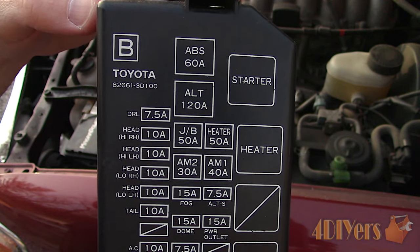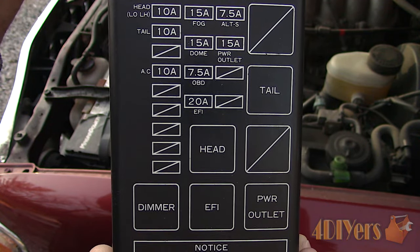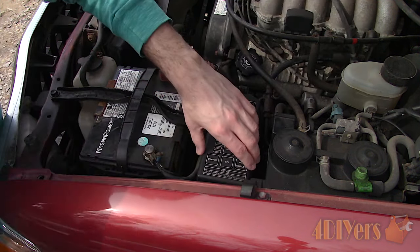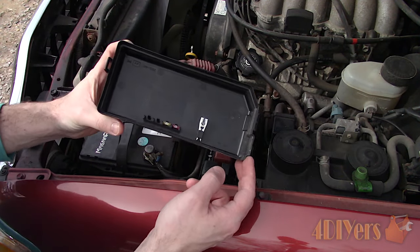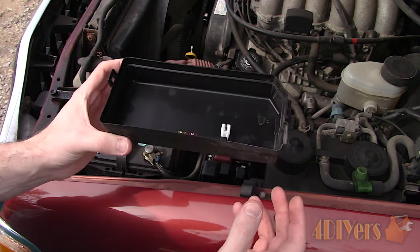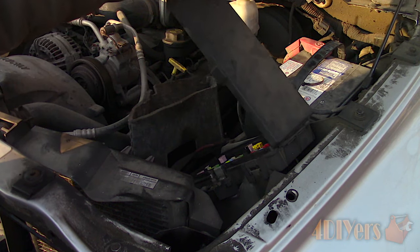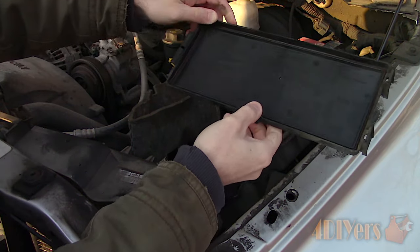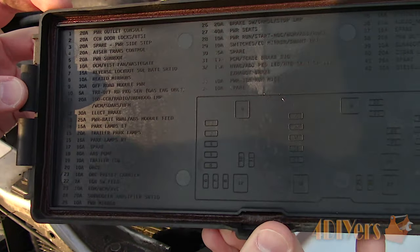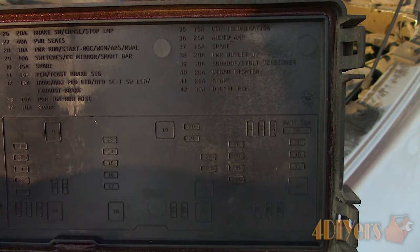Fuse diagrams can be found in your owner's manual or on the fuse box cover. The diagrams will outline the fuse for each circuit along with the required amperage. On this Toyota we have diagrams for the distribution box both in the engine bay and interior. Removing the covers will vary — typically there will be a tang that needs to be depressed, then pull up or pull off the cover. This distribution box has relays, however I won't be getting into that. In the cover there will be spare fuses along with a removal tool. As you can see, each will have different amperage ratings as shown by the number on top. Required fuse ratings will be shown on the distribution box cover diagram or in the owner's manual. Larger amperage rated fuses will have a larger profile and cannot be tested in place as there are no exposed terminals on top.